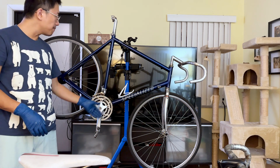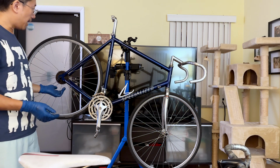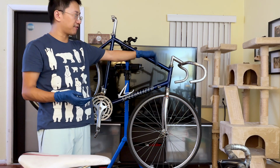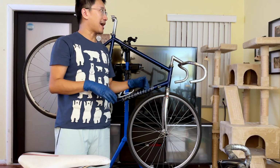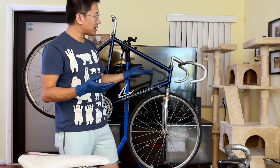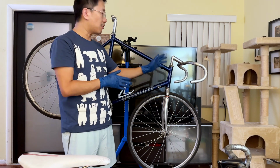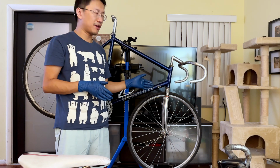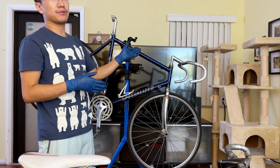This is a 7-speed triple. So whoever is gonna buy this, all they need is a 7-speed rear derailleur and a 7-speed 3x7 front shifter. They can either convert this to a flat bar or they can use a 3x7 speed shifter, which I think the Shimano Tourney nowadays still offers as an STI 7-speed setup. So they can use the Tourney shifter for the front if they want to keep it as a drop bar road bike. If they want to convert to a flat bar, super easy, and shifters are more widely available for flat bars as opposed to the drop bar shifters. So it'll be easier to convert to a flat bar, okay?